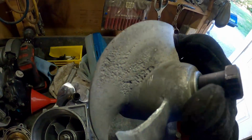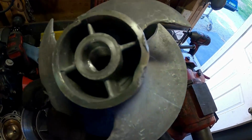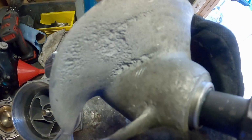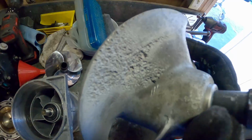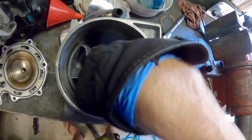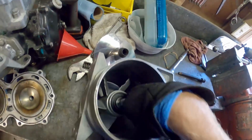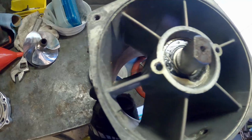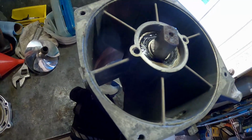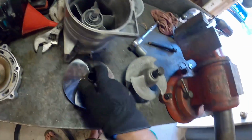It really has no bottom end until it starts going. Just feels like the pump is spinning. You can see it's really chewed up on the back here and here, there, tons of pitting right in there, also there, also there. And then we check out the pump and got a couple of breaks on the vanes in there. So I don't know, it doesn't look too bad, but it doesn't look perfect, obviously. So I'm gonna reassemble this with this one, and a little side-by-side comparison here for you.